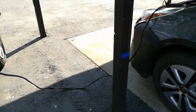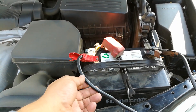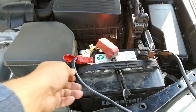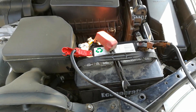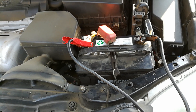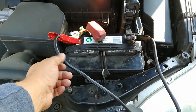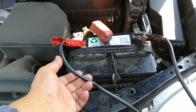While we wait, let's talk about jumper cables. The bigger your motor is, the thicker your cables should be. A cheap five-dollar set won't cut it for a big V8 or diesel — it may not work or may take a really long time. I'll have a link below for quality cables I've used. I prefer cables over jumper packs because I don't have to maintain them — those pack batteries go bad. For a small four-cylinder, cables like these can normally suffice.